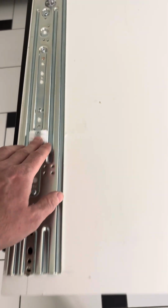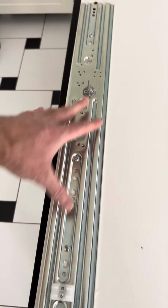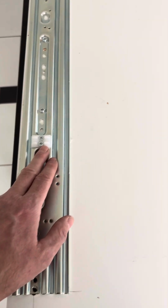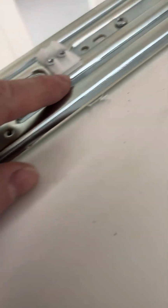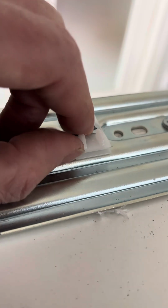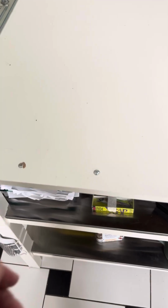So once you mount these things here, and these hooks, this metal hook on the bottom, and this plastic guide thing. Be careful with this plastic guide thing, it will break quite easily if you're not careful. That drops in here, and it rests between and slides up and down there. And then the hook, once you've backed off the screws, goes in there. And then once you've actually got the panel mounted, you need to run those screws back in again until they're snug. And the metal part goes in between. So you've got to be quite careful, because this can be a little brittle and break, speaking from experience, which I'm hoping this video will help you avoid.